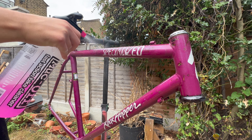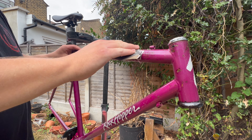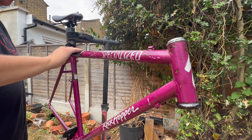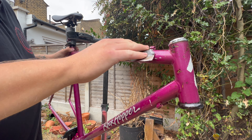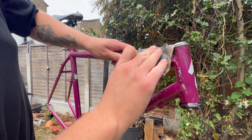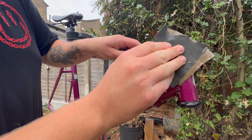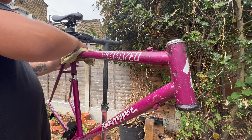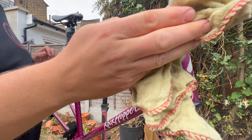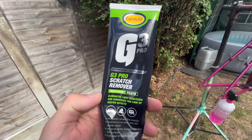Back to painting it on too thick - essentially it left this kind of residue around the edges where I was trying to buff the paint and repair it, because it was then covered with rust converter. Toasty said put it on first and any of the extra bits around the edge you can then get rid of. I really messed it up but I did fix it. Essentially I needed to wet flat it before polishing, and that got rid of it all but kept all the black, which was what I actually wanted - it just gave me an extra step. But you'll see the colour pops.